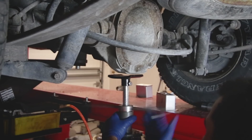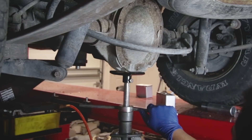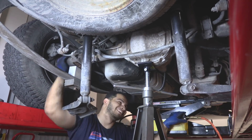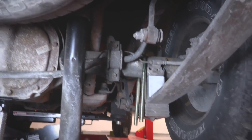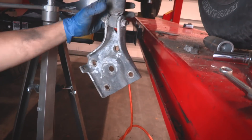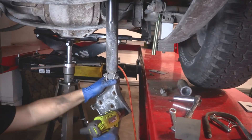While dumping your Ford Explorer on its wheel arches may be easy, you still want to be safe. Support the weight of the car and the axle. Remove the U-bolt nuts and gently lower the car. Then install your universal lowering blocks. We raise up the body, undo the four bolts on the plate, let that drop down, support the diff, lower the car, punching the diff and axles up into the air, then put in the three-inch spacer. Lowering blocks are installed.